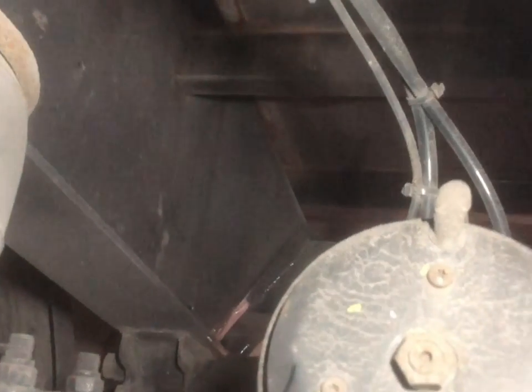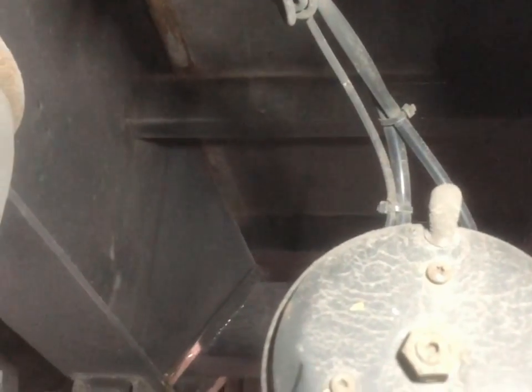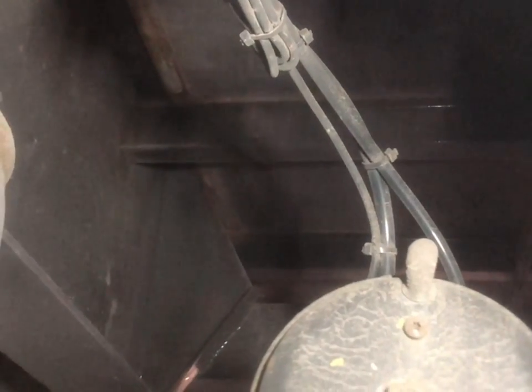So in there. Same again. Go into there. Same again. Into there. Right. About there. That one's fine. So over to there. And that's got a bit in as well. So that's which one it should be in. Which, as you can see, yep. However, it's also tracking across that one, that one, that one, and that one, which would suggest there's water in the plug.